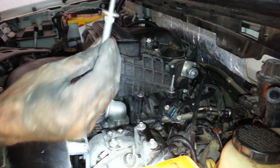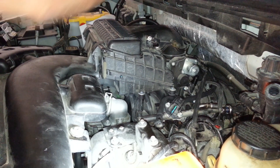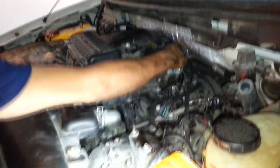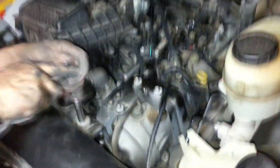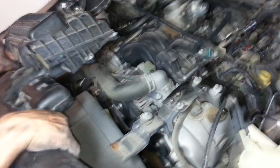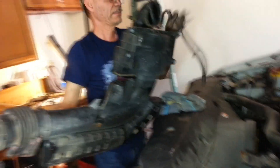This is pretty much what you're removing right here. Since you've already removed everything — all the hoses and everything — it's pretty easy. All you do is loosen it from back here, pull it, and it comes off the rail where it's connected. Pull it from right here. It comes off of there, and you also want to loosen this screw right here — there's one right here too. It's got like a self-alignment mechanism on there, and you just pull it and it comes right off. The air duct just lifts right off completely. Put that off to the side — you don't need it for now.